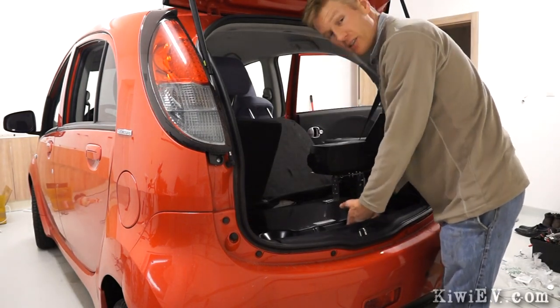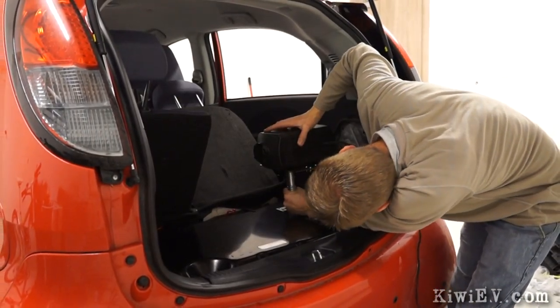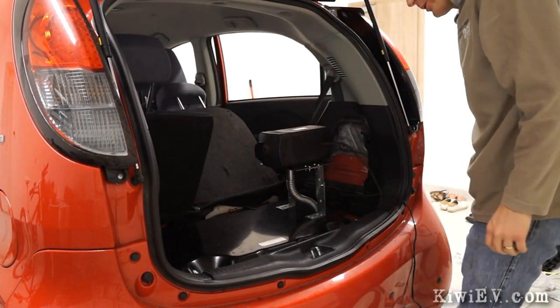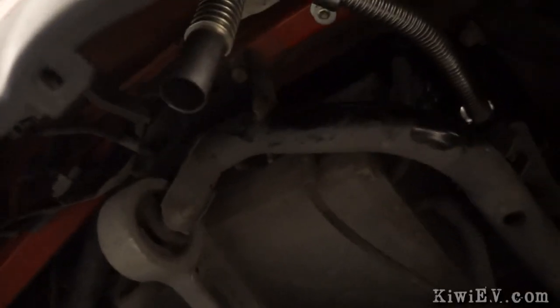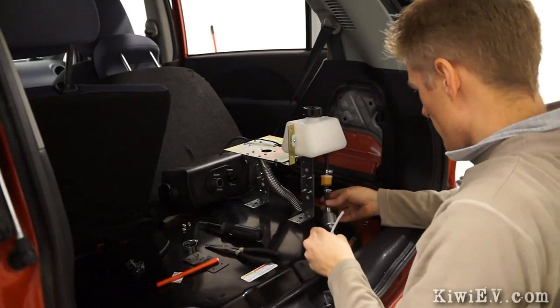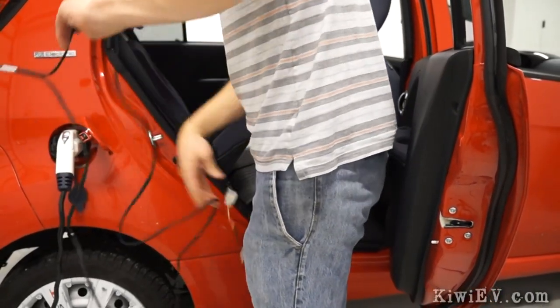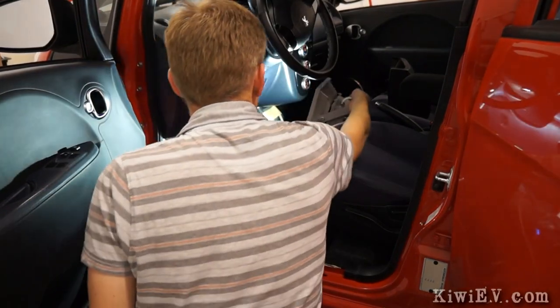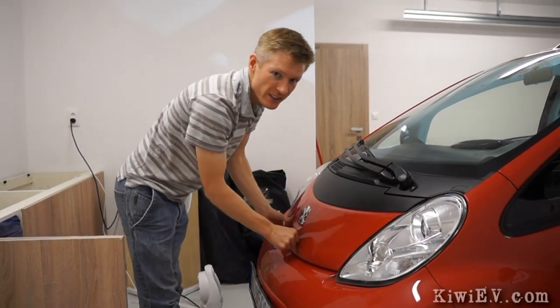Not that you would need access, because it's an electric car and there's nothing to fix. I got busy drilling out a big hole for the exhaust pipe and mounted it in the car, but the very hot exhaust pipe needed to be routed well away from any plastic or rubber parts. I'm now figuring out a good place for the exhaust pipe — at the moment I just have it aimed out the back, which is functional, but I don't want my electric car to have a visible tailpipe. I hid the exhaust pipe behind the rear bumper, away from plastics, and started to rig up the diesel fuel tank and fuel lines.